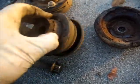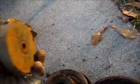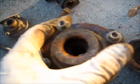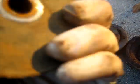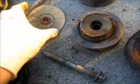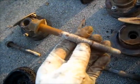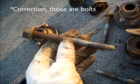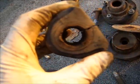This is the passenger side rear subframe bushing — here's the bottom of it, and this would be the top for the body. And here is the passenger side front one — this one actually has some rust on it. These nuts come off very easily; they're just sort of stabilizing the bushing. This one did have some corrosion on the body and it made its way onto this disc. These are 23, 24 years old, so certainly not new. And these are the sway bar bushings — definitely factory.